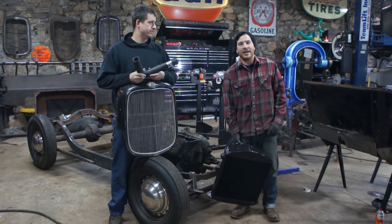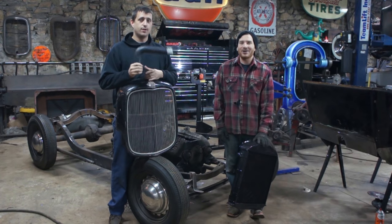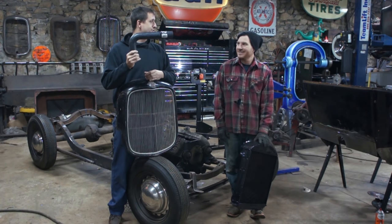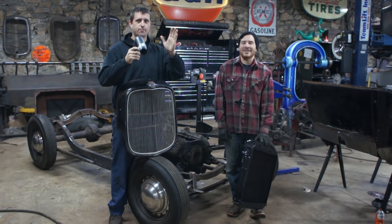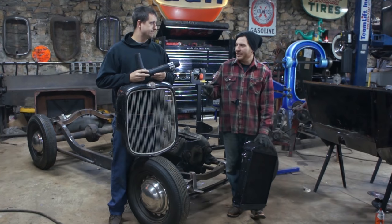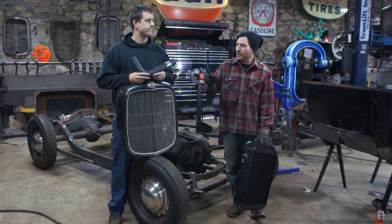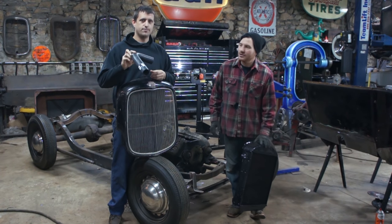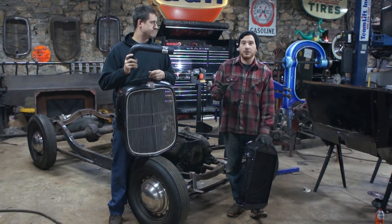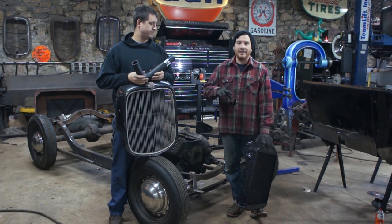So we're going to work on it. I did some internet searching and found just a basic 90-degree hose. You would not believe how hard it is to find a formed 90-degree radiator hose. We went to one parts store — there were hoses going in every direction except a straight 90-degree. We found some that were close but they had offsets in them and it wasn't going to work. Matt did some useful internet searching, ran part numbers, and we found it at a local NAPA Auto Parts. It's a Gates 20957 — just a simple one and three-quarter inch inside diameter with a straight and a 90 on it, perfect for a flathead V8 car. We found it should actually work on the top too, but we're focusing on the bottom today because that's the most unique and challenging part of this setup.